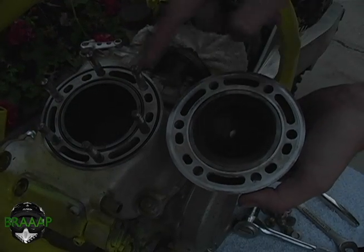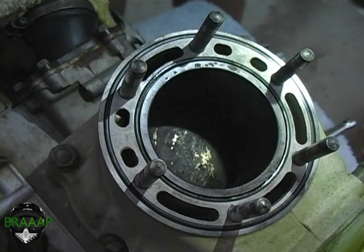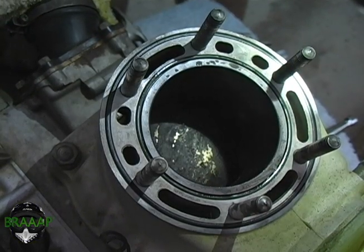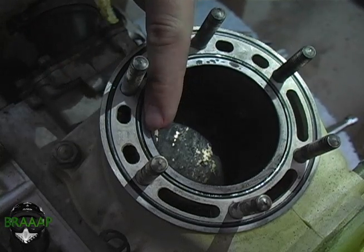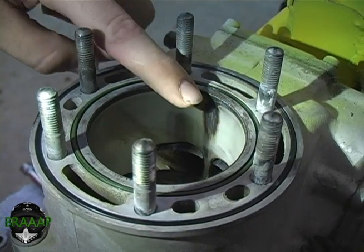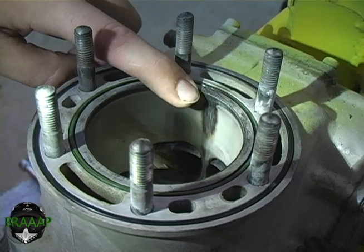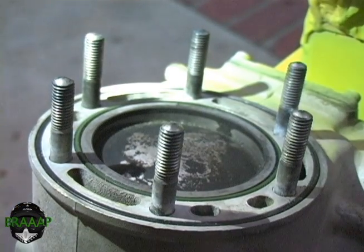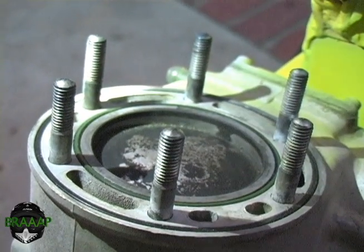You can see what the head, cylinder, and piston look like. By using a high-power flashlight, you can look at the 2 rubber O-rings and the cylinder wall. The brown streak on the cylinder wall means it has scarring or a seizure. What you should do next is remove the carbon on top of the piston to find out what size your piston is.